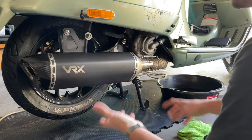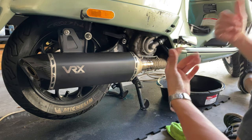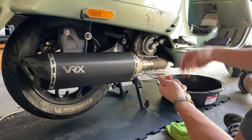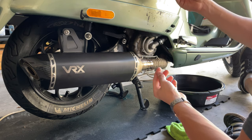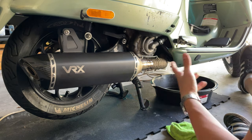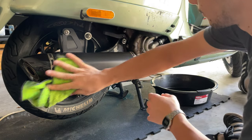So once you're done with the coolant flush, you run the bike, you let the bleeding screw get all those air bubbles out of it. You actually want to run the bike until you see that fluid from the little hose from the bleeding screw come without any bubbles from any air. And as soon as you see that coming out with nothing, you can top up the coolant. And once you refill that, you are pretty much ready to go.